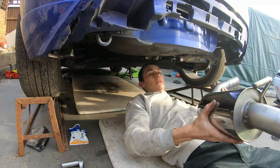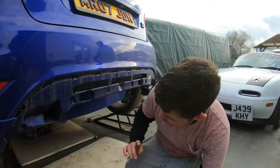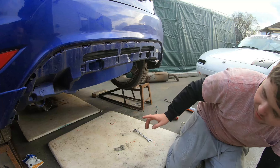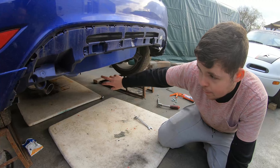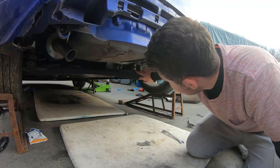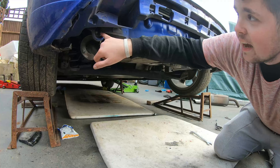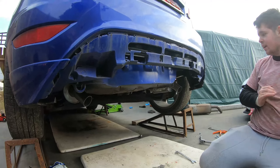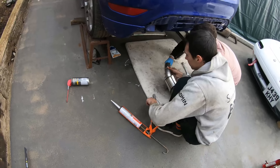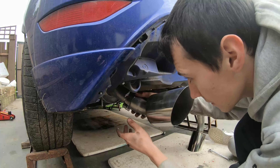The next bit is the mid pipe that comes across, goes around the wheel well, and onto the hanger we've just made. Quick overrun of what we've done so far: from the cat back we've put the adapter onto the mid pipe — no resonator on it. Then from the mid pipe we've got the bend that goes over the axle. From there we have our first back box that crosses over to the middle of the car. Then this side on with this hanger through here. Now it's just a case of putting the tips on, the rear diffuser, and we should be done. Four and a half inch — lovely. Time for the tips.